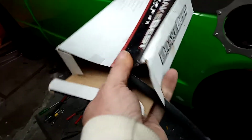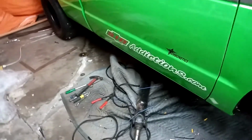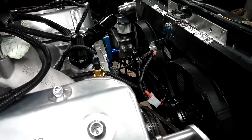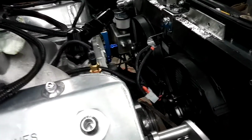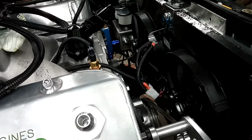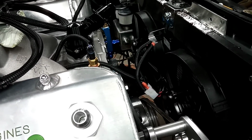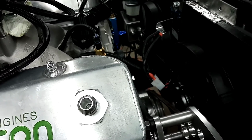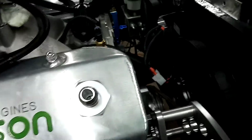I'm going to get ready to put the brake rubber lines on. I just went through O'Reilly's for the rubber lines for the 8.8. It was $14 for both of them with my son's discount. And then the next thing's going to be starting building a lot of AN lines. So I had to get special hose for the transmission. It's got that liner in it. And all the fittings are all Vibrant. I've had good luck with Vibrant stuff. And then all the hose is just Earl's hose. I think the transmission hose or the dash 16 hose, one of them is AeroQuip, but the rest of it's all Earl's hose.